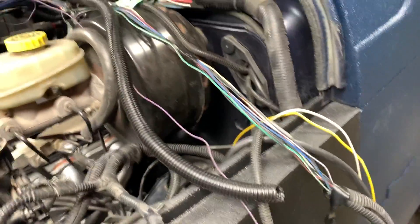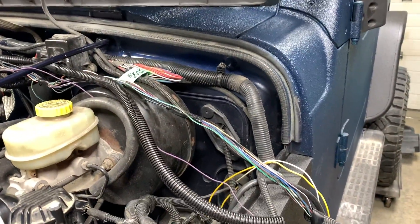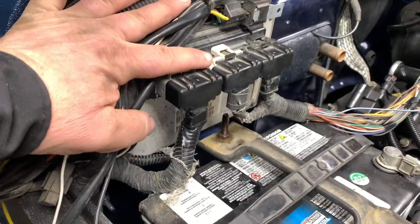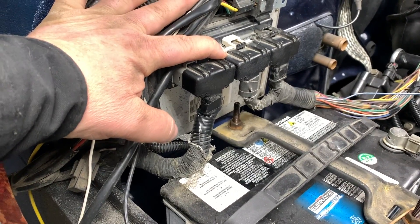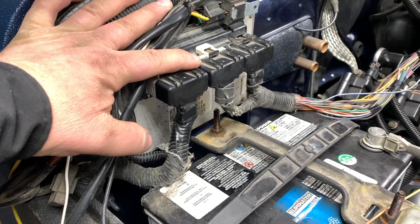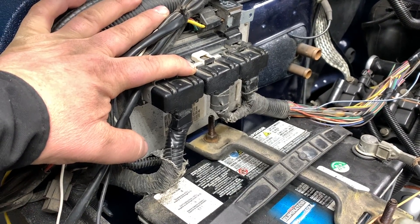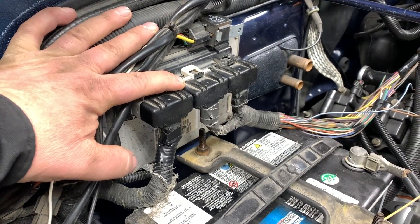The first part of this video is being filmed pre-Cuba, so I'm going to go back and attach all that I took apart. I was trying to figure out what was going on and I figured it out. The gray plug here is your CAN bus - that's the one that communicates with the OBD scanner and makes sure the dash works properly. What was happening, as you guys saw in the previous video, is that the key ignition would stay on, the odometer worked, but the gauges would not work - no communication with the scanner.